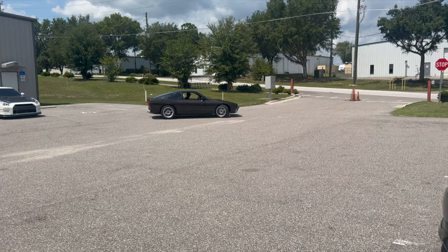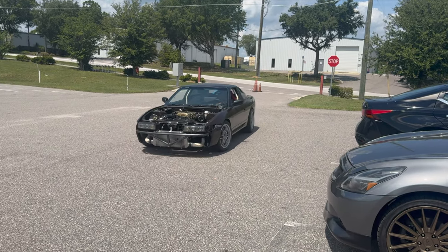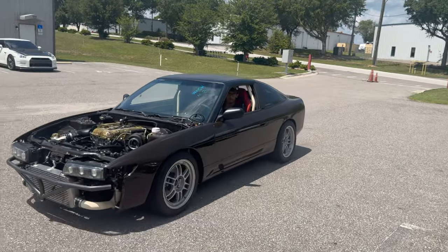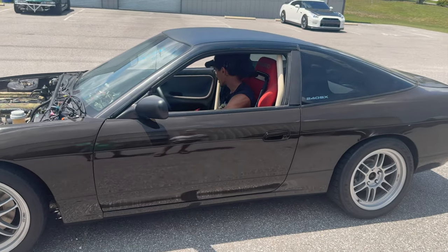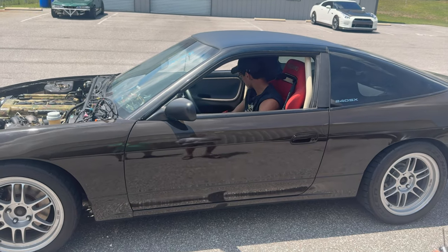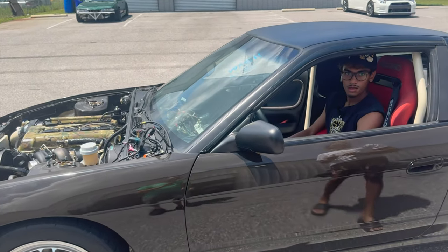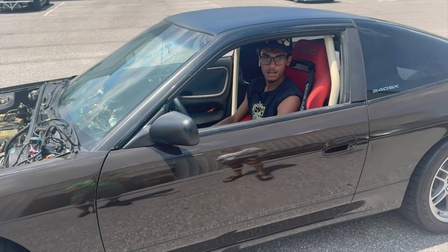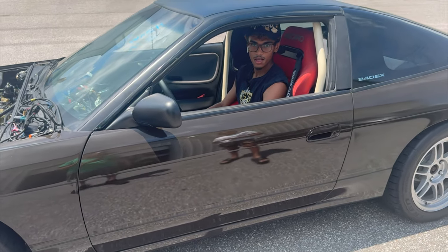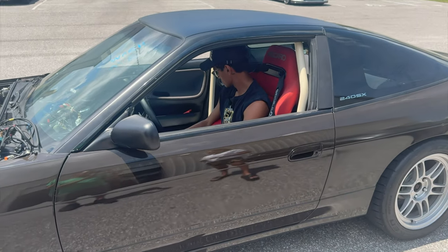So that's after we did a slight throttle chamber adjustment to bring the idle up, to clean it up a little bit. Yeah, we have to change it a little bit, I think. Yeah, we'll have to recalibrate the TPS and then go from there with it. But it was better there. It responded. Yeah, it'll respond. Everything's better. That's what we do. We make it better a little at a time.